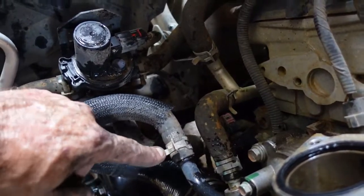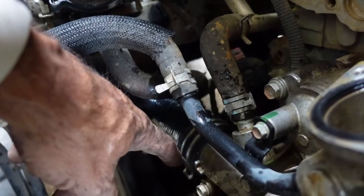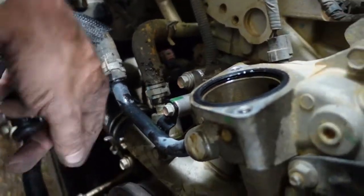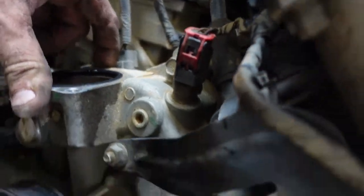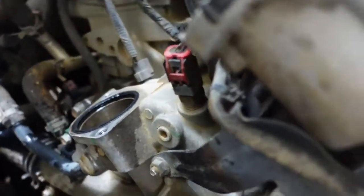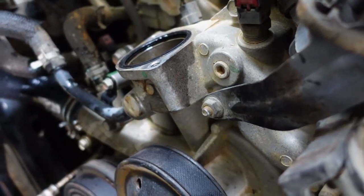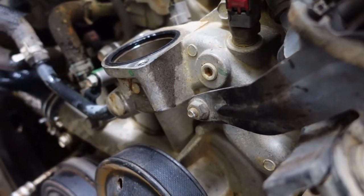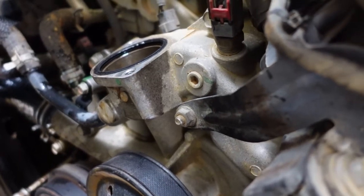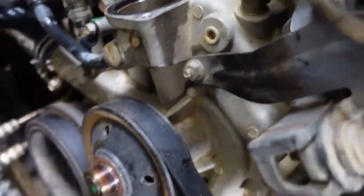But yeah, once that bracket's off, we'll test my new tool for these type of clamps, since we got to take that one and that one and that one again. And then I think, oh, yeah, well, then we got a temperature sensor probably. Looks like that's a double lock. So, I think once that all's off, we may have the ability to pull the water pump, which looks to be maybe 12mm screws or 11s, hopefully 12s. Doesn't look like 13s. It's probably 13s. I don't know. I'm rambling. So, belt first.